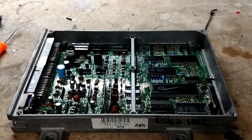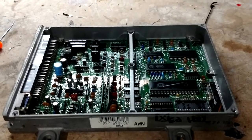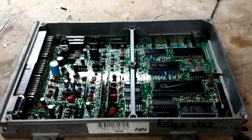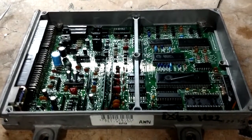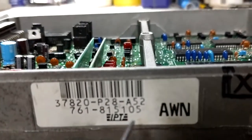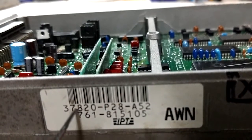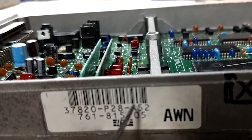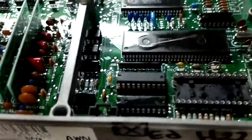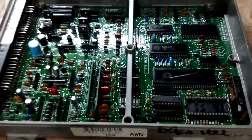One of the things it pinpoints to is your ECU. Everybody knows there's either a five-speed or automatic ECU, and either of those can be chipped. Mine unfortunately is an automatic, and you can tell right here by the A52 — those last three numbers of the serial number — that's what indicates if it's a five-speed or automatic. There is a way to convert it.